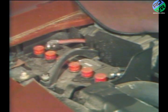Of course, no one knows exactly how quickly. As a general rule, customers do not like to take chances with their batteries. If you stick to your high-rate discharge test as your guideline to battery condition, you might replace some batteries that could have been nursed along for a few more weeks. But is the risk really worth it? Batteries are seldom repaired in service. Likewise, regulators. Alternators are another thing.